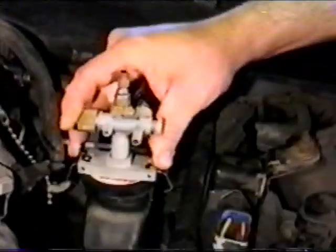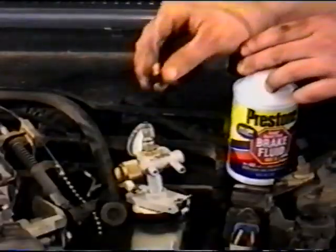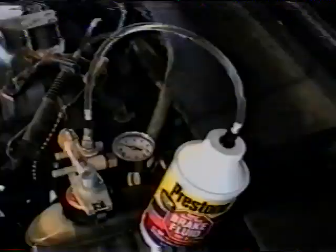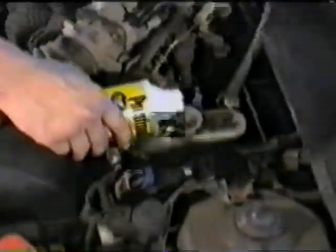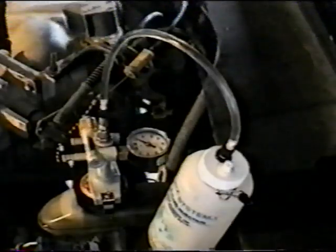To use the UCA to allow for automatic fluid replenishment during vacuum bleeding, attach the UCA according to the previous steps. Next, connect the new fluid source to the fluid inlet of the UCA as shown. This will allow fluid to be drawn into the reservoir when needed during vacuum bleeding, avoiding the need to refill the reservoir during the process. The UCA can also be used during the RFI bleeding process to avoid overfilling the reservoir. Simply connect an empty capture container to the fluid inlet of the UCA and proceed with the RFI process.